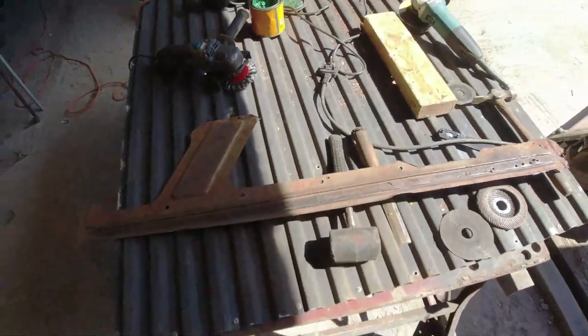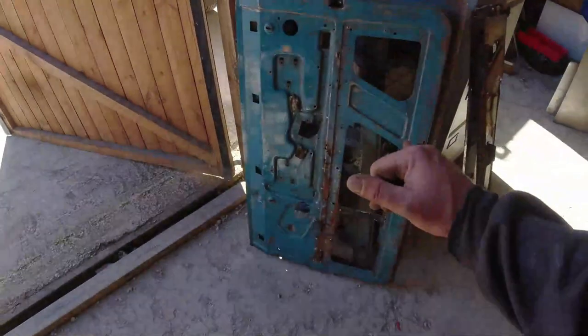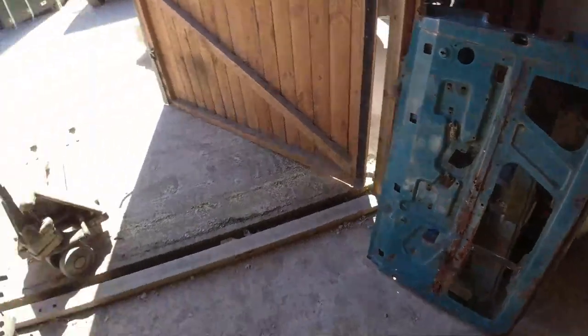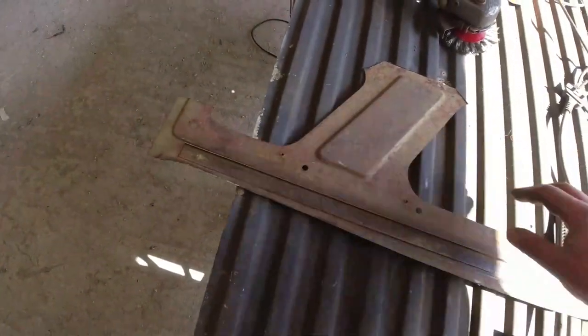take this rib off. I'll put the skin on here, and I'll make up a new reinforcing rib that goes on the back. I think that's going to be the easiest way of dealing with this. On the back here, you can see it's just very light surface corrosion. So there you go. Even though the door looked terminal, don't chuck things away, chumps. There were bits I could salvage out of that.